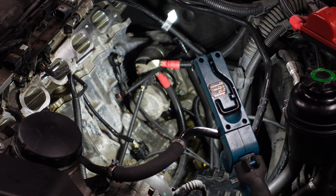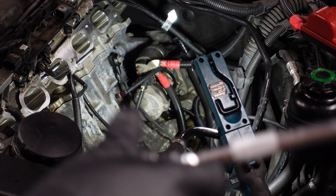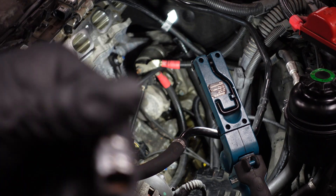As you can see I am now going to start removing the bolts. It ain't going to be as clear as many of you guys like to see because obviously the camera's on a tripod and I have to go down there. But I've shown you where the bolts are so you'll get a drift of exactly what I'm removing. For this we're going to need a certain amount of tools. We're going to need a long extension to get in there at first, and then we're going to need our e-torxes — an 11mm e-torx — which we're going to be using to remove the bolts.